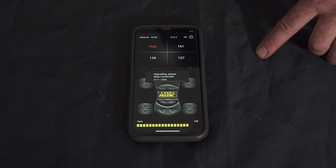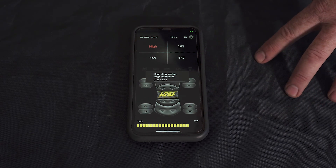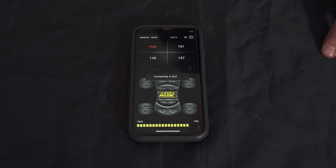When the ECU is almost finished loading, you'll see the number on the left climbing will equal the one on the right. The ECU will then reboot and you'll be updated with the latest version available. If you need to update in the future, you can simply go back and repeat the process for any new updates that come out.